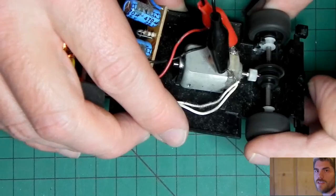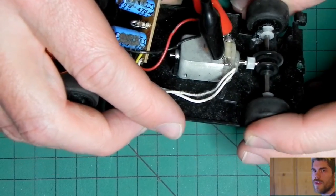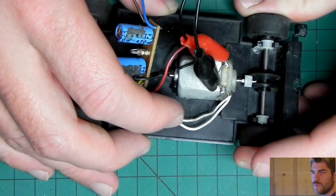Well I managed to finish that. I realized if I ran the motor and let the axle spin around inside the wheel hubs it would actually force the air out — so that's the way I did it. Now the wheels are as far in as I think I can possibly get them. I just have to hope that none of that epoxy resin went into the bearings because that'll be game over — or new axle time anyway. So tomorrow I think it'll be time for a track test and I'll probably start working on the new spoiler.